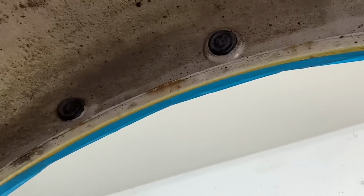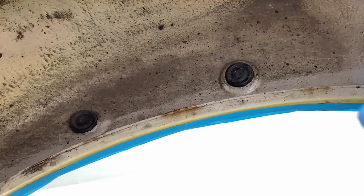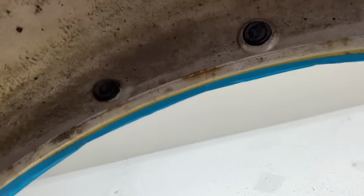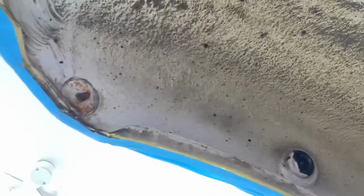But at the same time, we can deal with making this arch a better clearance for a wider tyre, lower car, if it's going to have CSL wheels, lower offset, things like that. So that's going to be all improved. We can take care of the corrosion that sometimes builds up on the edges around the bumper bracket as well, which sometimes causes corrosion growth around the outer panel. That's where people most often see that.